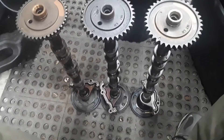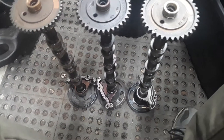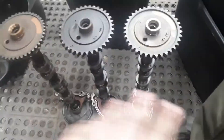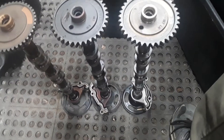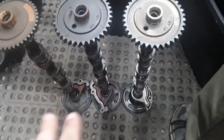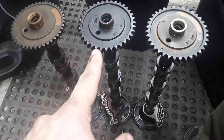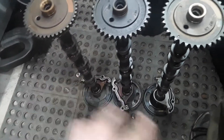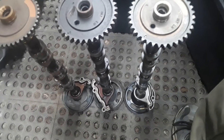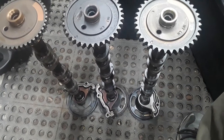These are all three of the Ford Duratec V6 camshafts. As far as I know, there's only three. As far as this engine and head arrangement goes, these would be the cam-driven water pump Duratec V6s — the 2.5, the 2.5 SVT, and the 3.0. They're all that same 60-degree Duratec V6 from the 90s to early-mid 2000s.